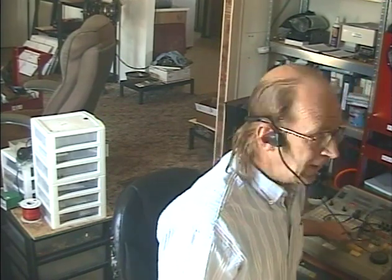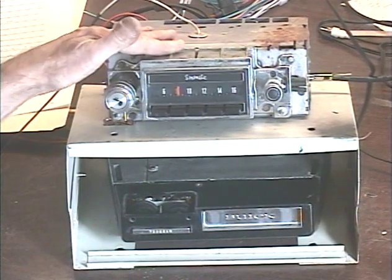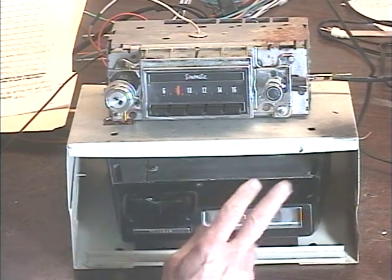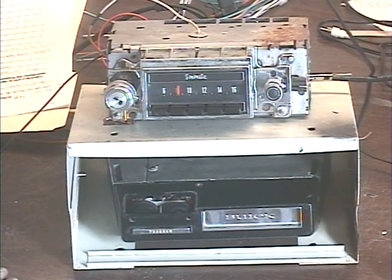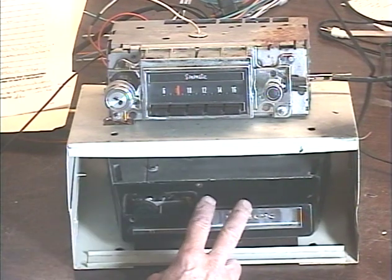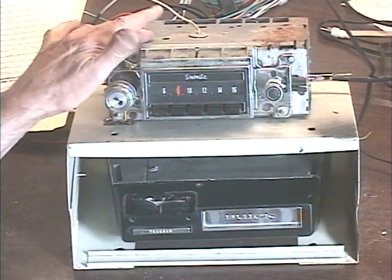What better video to use for number 500 than my own little development — the full Delco system conversion. This radio has been converted to modern electronics for that massive increase in output power, improved signal reception, aux input, and all that cool stuff. But that leaves the 8-Track high and dry, because the 8-Track is designed to work into a common-ground speaker system and will not work with a converted radio wired for maximum output. So the 8-Track, at the very least, needs to have a line output added to feed the aux input on the radio.